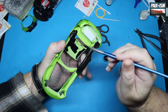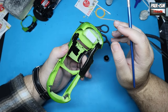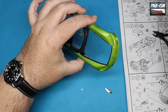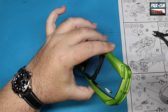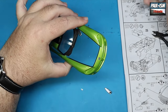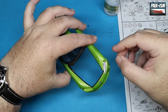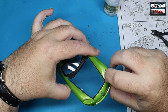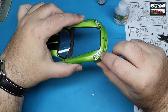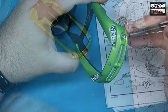I did polish the exterior, but I only flatted it back with 8,000 Trizact pads and the UMP polish, because the 2K was that good. It really didn't need a lot at all. It was absolutely phenomenal. Like I say, I'm still toying with the ratios on the thinning, but I think we're getting there. We're getting better and better. We're just trying to improve what is already perfected and making it a bit easier to use. And I think definitely thinning the last coat is beneficial on the 2K. But yeah, there we go.